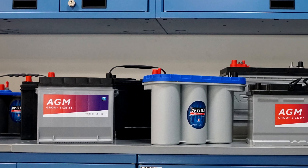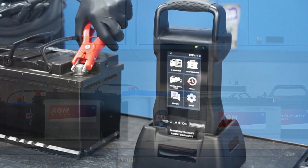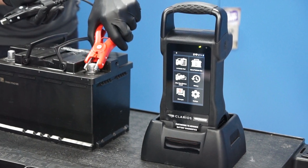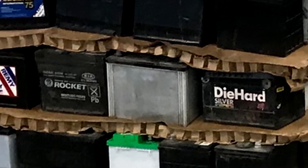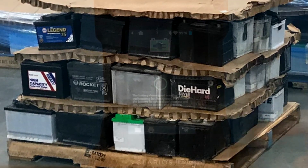Welcome to the battery shop. In this video we'll discuss how to correctly test a new battery. Handheld testers were developed to give customers a rapid state of health of their battery. The algorithms in these testers were developed from data collected from junk battery studies. Junk batteries are collected from the field and range typically from 50 percent through life to end of life.